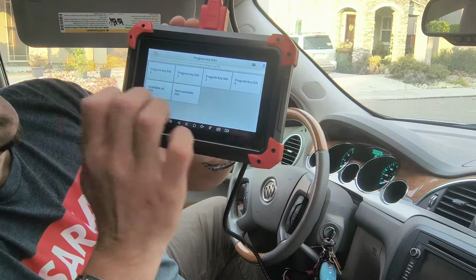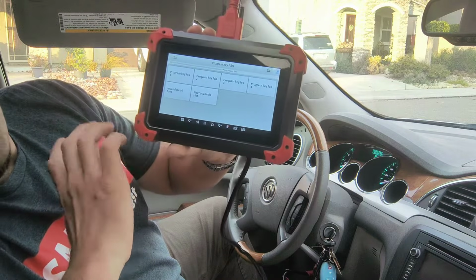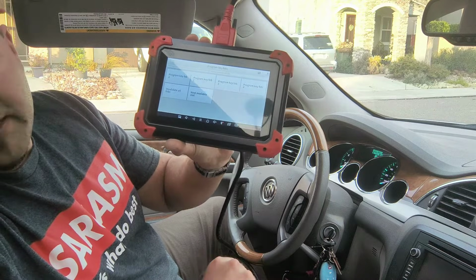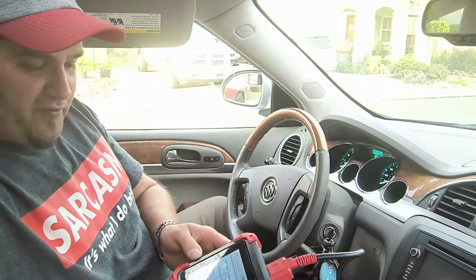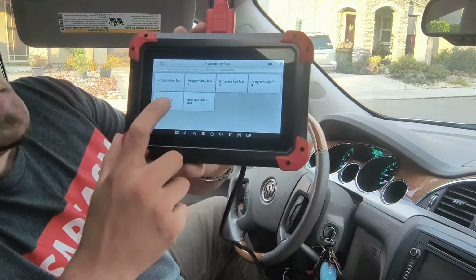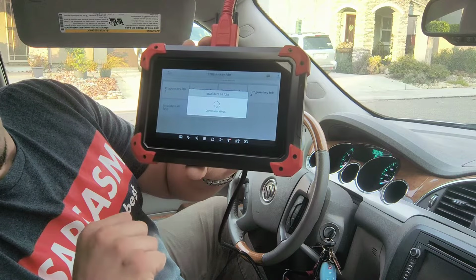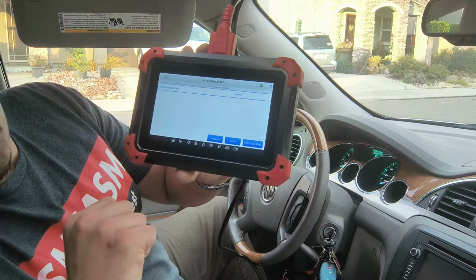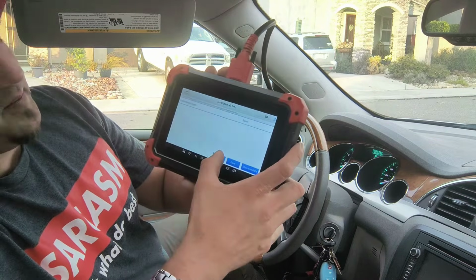So click here. And then what we're going to do is clear out all of the key fob history that is currently saved in the vehicle. I'm going to start this over to make it seem like it started off fresh. By doing so, invalidate all key fobs. So I'm going to click that there. Now, because I've done that, our other key fob that we have, it will delete the retained information. And then I'm going to reprogram each one of the key fobs. So I'm going to hit program.